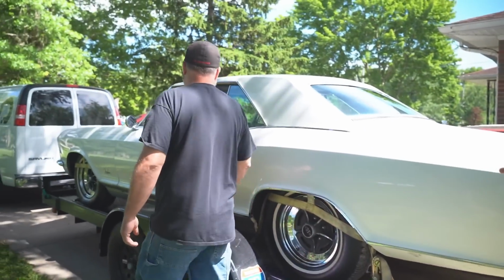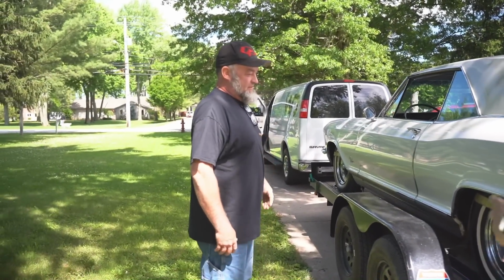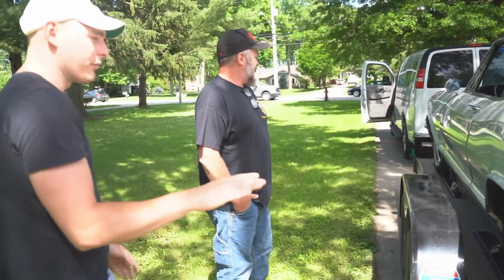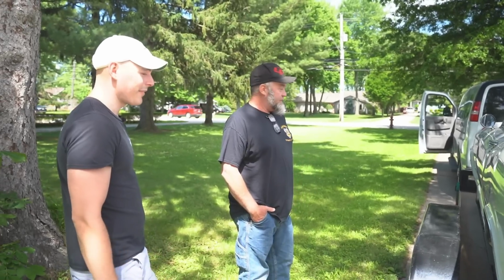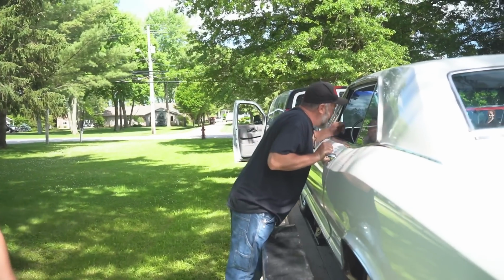So with the wheels, with all the pitting, we actually went ahead and tried our best with some quad zero steel wool and metal polish to loosen up and remove as much of that pitting and rust as possible. So I understand it wasn't going to come perfect, but they're shiny. It's beautiful. Oh, wow.